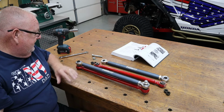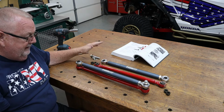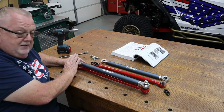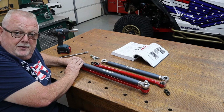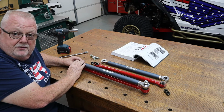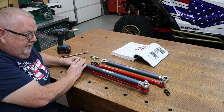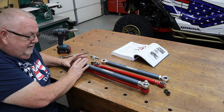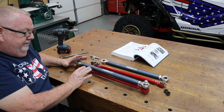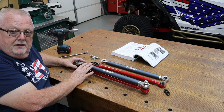So like I said, basically it's just put the bushings in here. I just put a 12 millimeter bolt in there with a nut, bolted the small end together, and adjusted the big end till the holes absolutely lined up. It's super easy to see just looking down through there that the holes are either lined up or they're not. So these bushings are exactly the right size. Everything's exact here. So we're going to go over there and start getting it apart, and we'll reset.